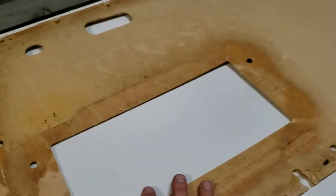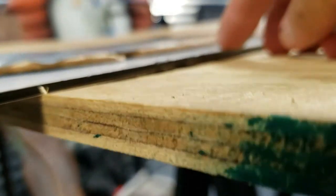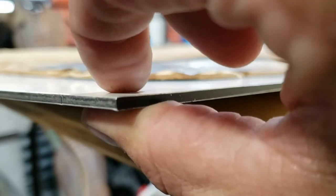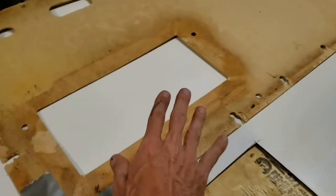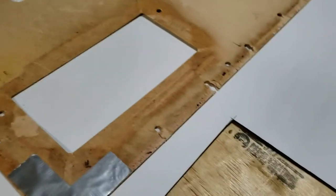Okay, so here's my door panel, and here's the board that I'm gonna be making the door panels out of. So what this is, it's called Max Metal, or it's also called Dibond, and it may have a couple other names, but it's what some of us in the sign industry, when I used to work in the sign biz, we make a lot of signs out of this because it's a thin piece of PVC sandwiched in between two pieces of aluminum. Painted white surface on both sides. You can also get it with just a bare metal aluminum side and then a white painted side. So this is double-sided, but it's very rigid. It's nice, and you'll see why by the end of this video why I'm gonna be choosing this material over something like this. I mean, there's obvious reasons that this is never gonna fall apart. This clearly did. But besides that, you'll see why I'm using this coming up towards the end of the video.